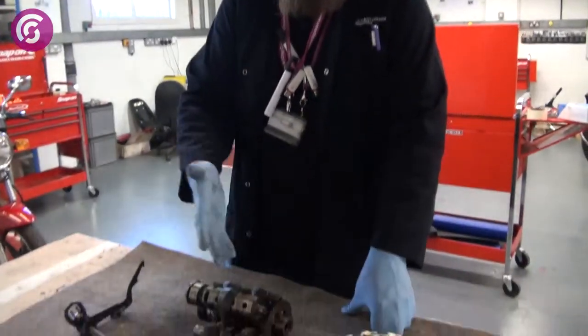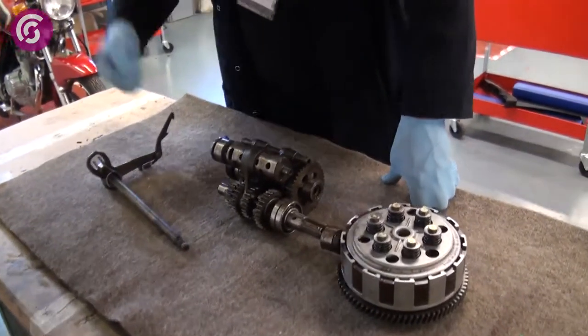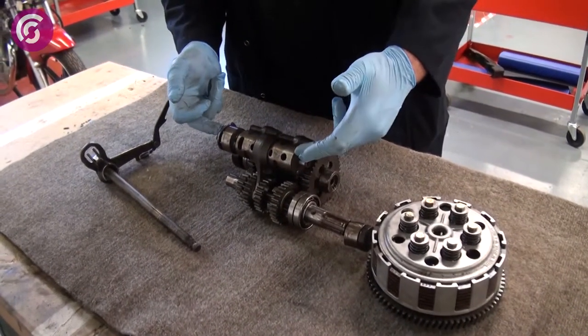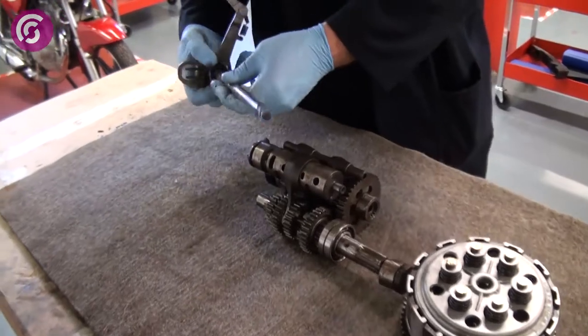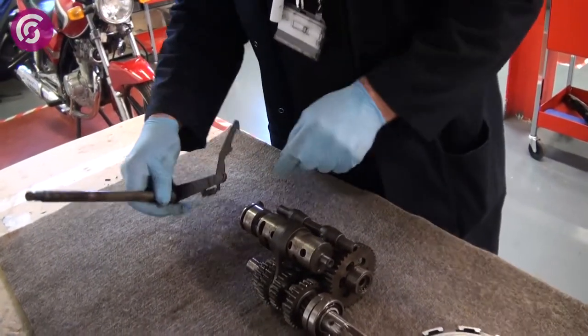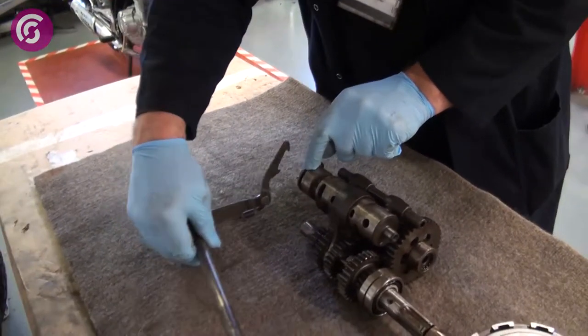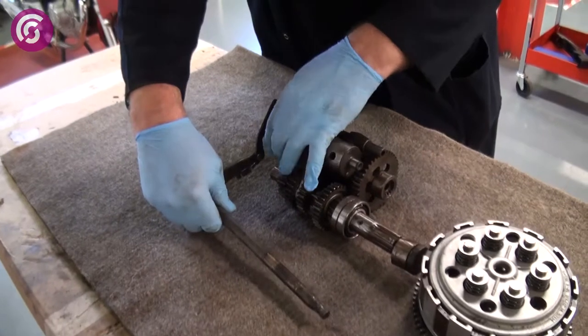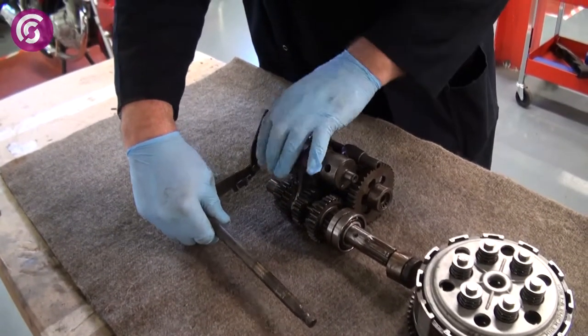This next video is to help you with the MC6 Task 2, which is a gearbox unit. Here's an exploded view basically of a gearbox. You've got your drum, your selector drum, your selector fork, selector arm — that sits into the pegs, and as your foot goes up and down the gears, that slots forwards and backwards.